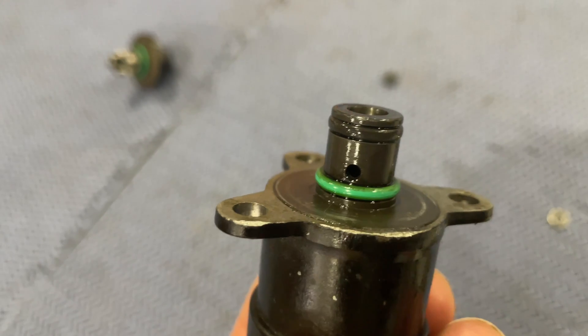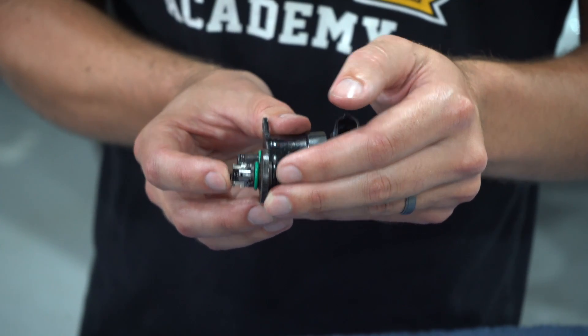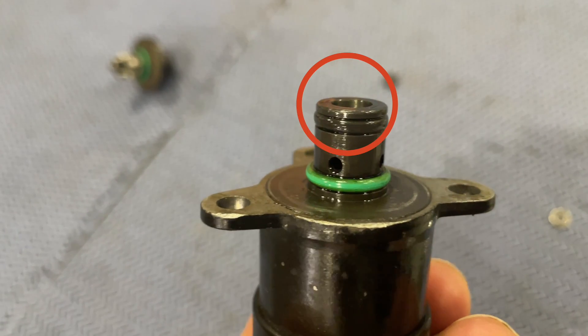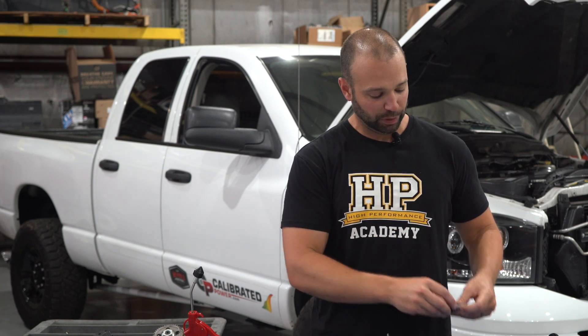Let's look at how the regulator control system works. Inside the housing is the pintle, then we have this front half, which I cut away for convenient viewing. The pintle acts on this slide piece, which sits inside the end of the housing. Fuel pressure wants to come in this hole, and as that fuel pressure comes in, its outflow is regulated to these four holes on the outside of the regulator. With no current — meaning the system's full open — we'd have full fuel flow outflow into the CP3 pump, meaning the pump can make the fullest pressure and move the most fuel mass.